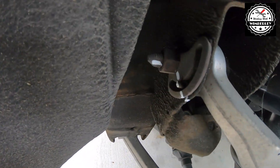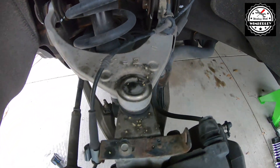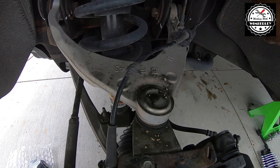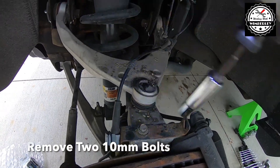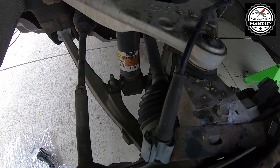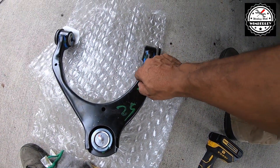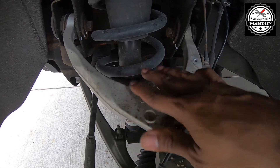I have my markings on both sides. Now the next thing we're going to do is remove these two 10 millimeter bolts so that we can get the level sensor off to the side and get the ABS bracket out of the way. That first bolt I'm just going to put back in place so I don't lose it, and the second bolt I'm going to loosely thread into the new control arm so we don't lose that one. This gives us room to get to the control arm.